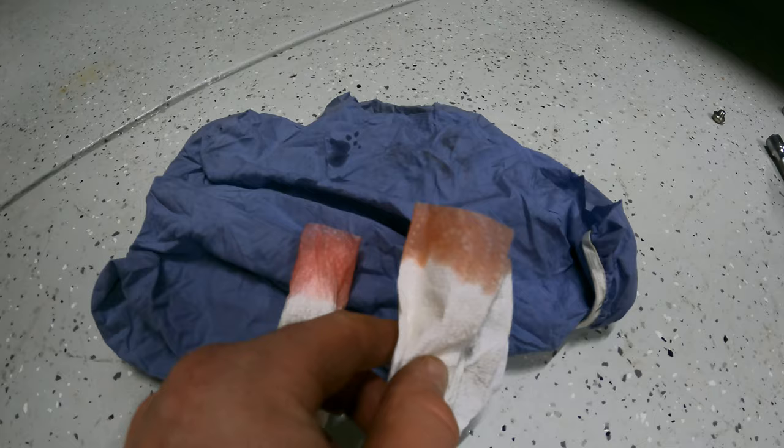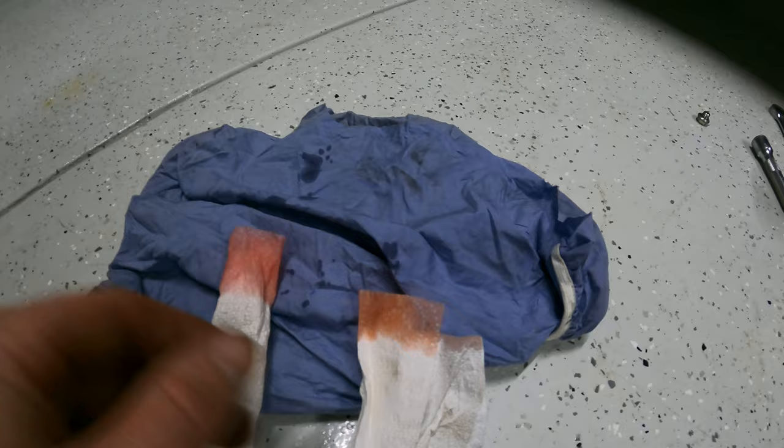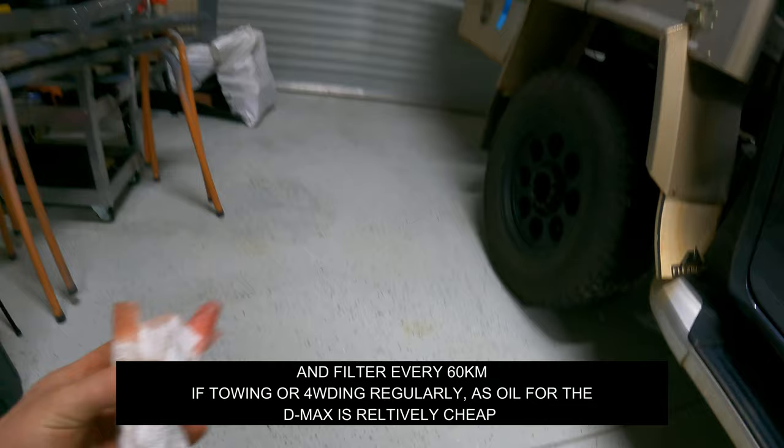So on your left is your new oil. You can see it is starting to brown off, but if I saw that in someone's car I'd say look, plan it in sometime in the near future but it doesn't have to be done today. Looking at the oil it does look really pink, but obviously when you put it side by side with the fresh stuff you can see it is slightly burnt. At 20,000k's on this vehicle, I recommend doing trans oil every 30,000, so he's just a little bit earlier. But you can't beat preventative maintenance.